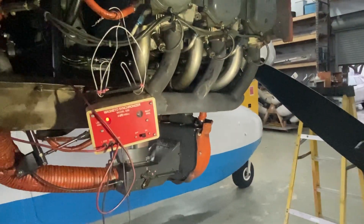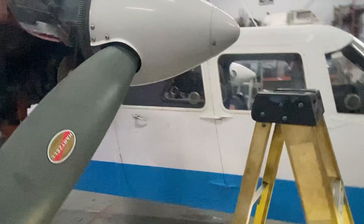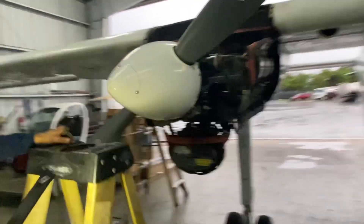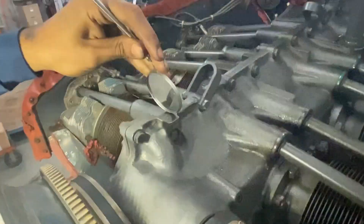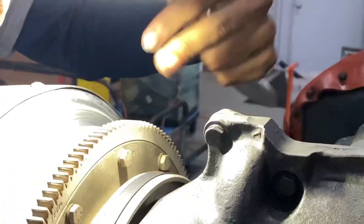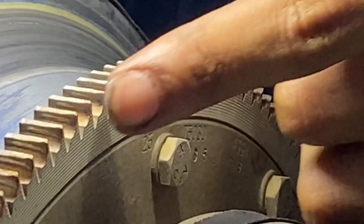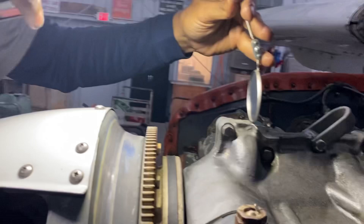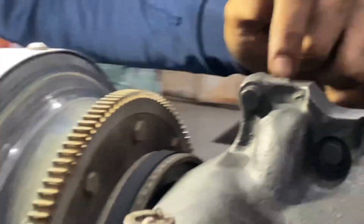You should get left first and then right coming on. Now I'm going to show you the marks up top. You're going to come up top — this is the seam of the case right here. On the back here, which is kind of hard to see, there should be a 25 or a 20 either direction. Looking at it right now, we are on 25 on the dot in the seam of the case, which is top dead center.